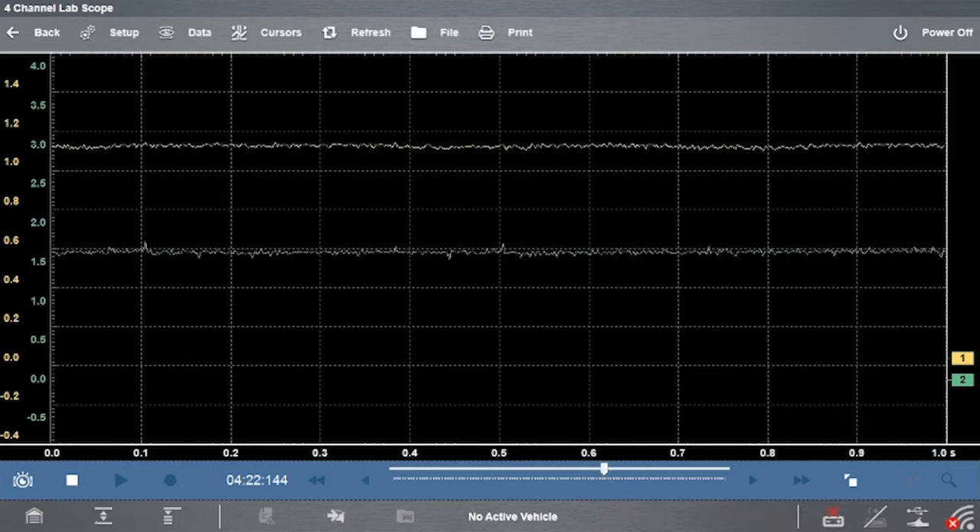I'm confident now that we can sell these thousand to fifteen hundred dollar struts and not find out afterward that the circuit or the module can't carry the load. I hope you learned something here from this newer generation MagneRide. It's a little different control — we saw it's not pulse width modulated to those struts. It's more of a solid voltage control, turning it on and off to stiffen up those struts. For more videos like this, hit that subscribe button, smash the thumbs up, and for more information on Garage Gurus, visit garagegurus.tech.